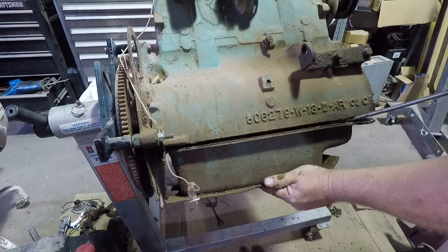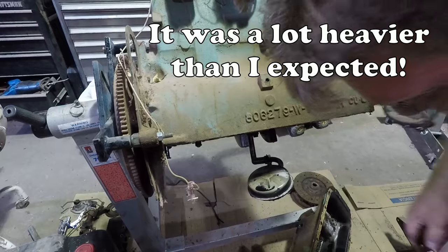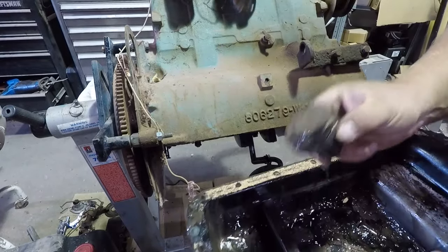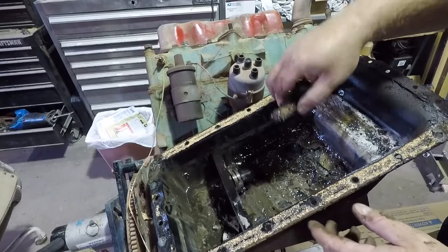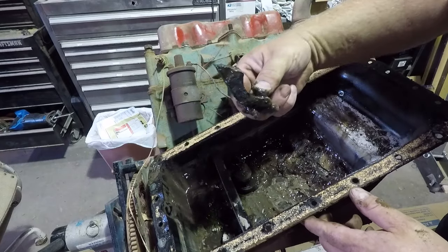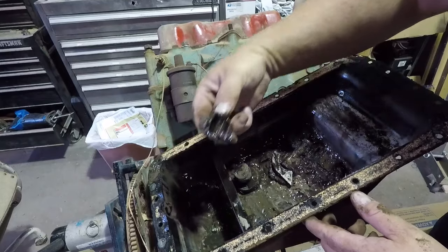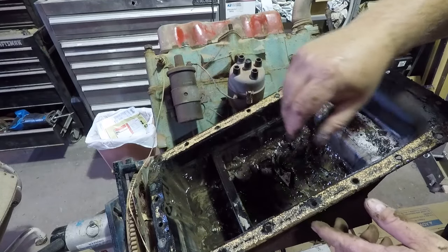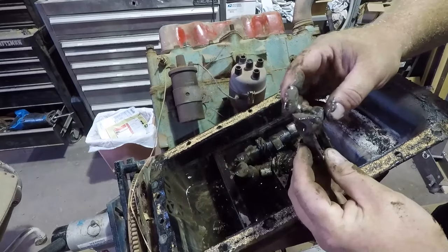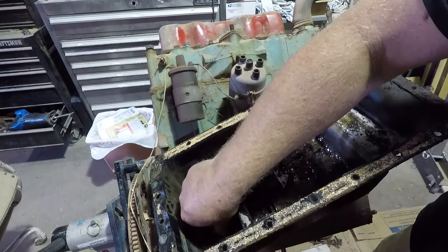This is the engine that made those horrible clanking noises and had the broken oil pump, so I'm pretty sure there'll be metal bits inside. Some nice chunkies. It definitely doesn't look good, but I can probably just take off the pan and see what kind of shrapnel there is. We definitely have metal: a piece of camshaft, a lifter, another piece of camshaft, a piece of block — that's bad — a connecting rod, another piece of camshaft, unknown metal junk. So this motor is trash.